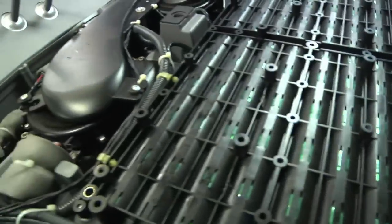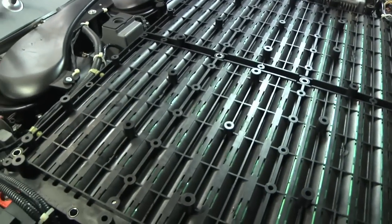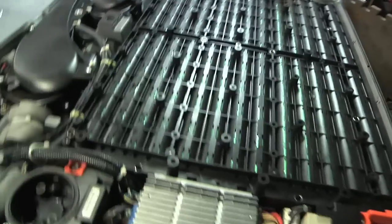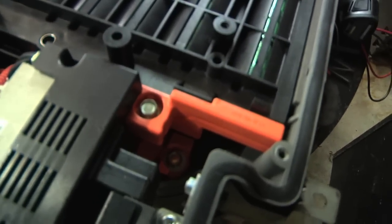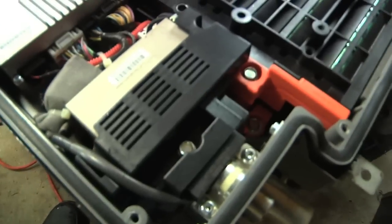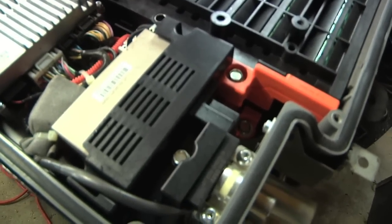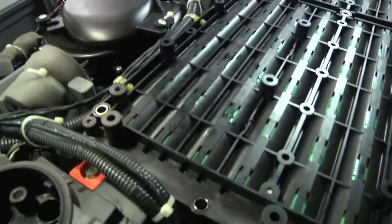Took them all out and it only feels just a little looser, so the cells themselves are going to have some weight. I've got to take a look at the zip ties and different things to see what else is holding this pack in. I'm also trying to generally avoid the orange stuff, as that's where the high-voltage connections are. Although right here is actually the main contactor, so in theory, as long as that's not closed, nothing's coming out to the power ports — but I still have to watch voltage internal to the pack area.